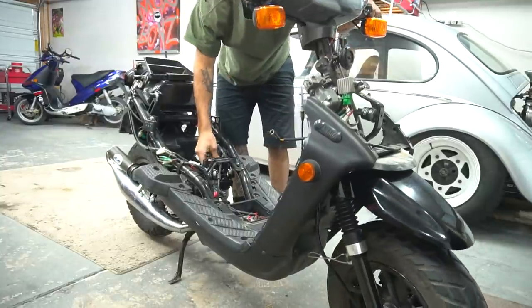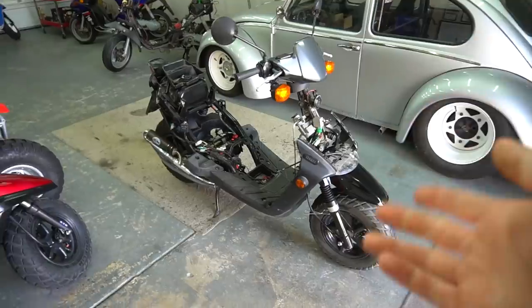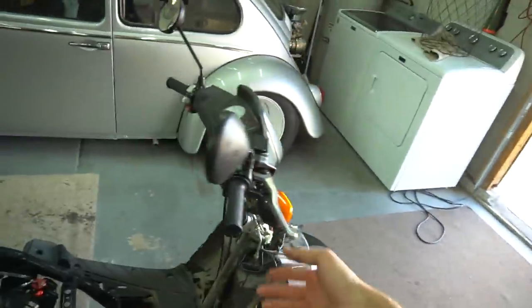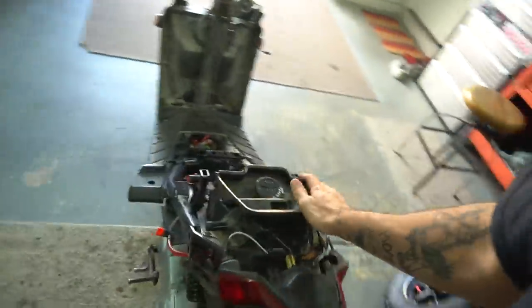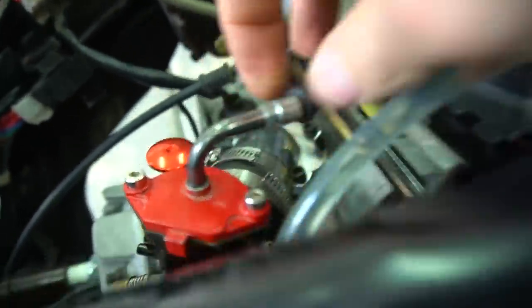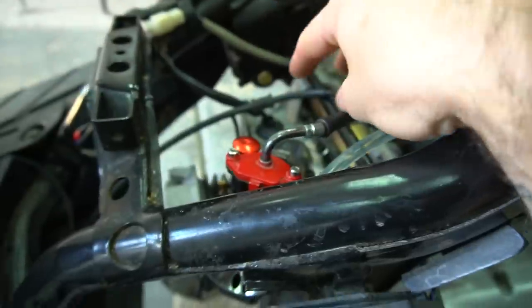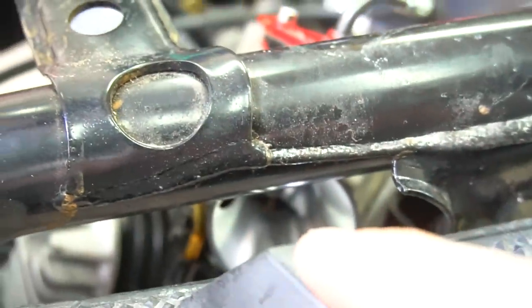Oh man. Well, boys, the bug eye runs, but it doesn't do as much good right now because this throttle cable is definitely giving us the issue. Which sucks. Pull this out, and this nut won't go in anymore because it has like a space right there. But if I pull this nut off and put the throttle cable back together, I think I can make it work because it's just a little too short. It's just barely picking up the carb right there.